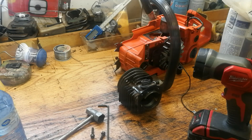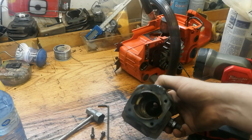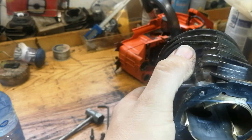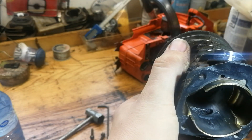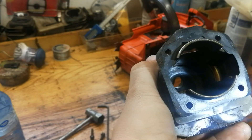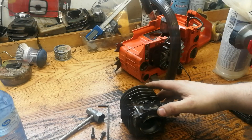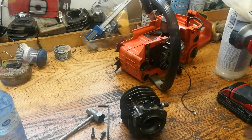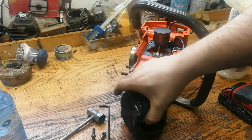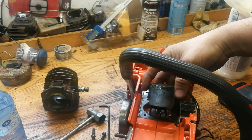Here's a quick one for those who have never cleaned up transfer in a cylinder with acid. This is a 55 Husky 46mm open port with a fair amount of transfer. I don't know exactly the story on this - it's going to be built for a buddy of mine. It came to him from a neighbor and was said to have all kinds of compression but it won't run. It didn't have any spark, and that 'all kinds of compression' - yeah, that's 30 pounds. Have a look at the piston. Clearly it's toast.